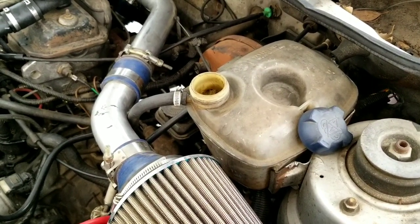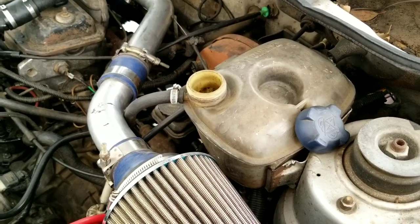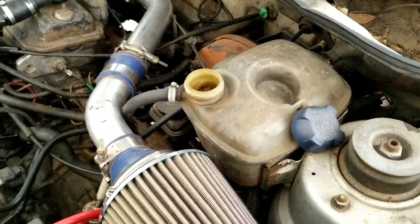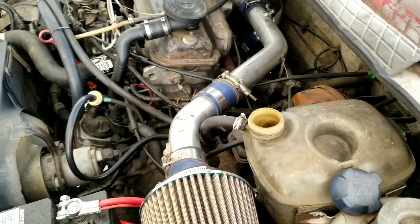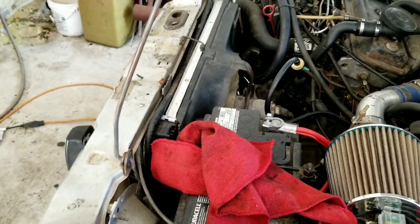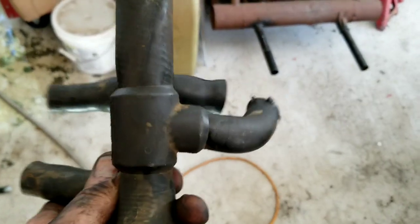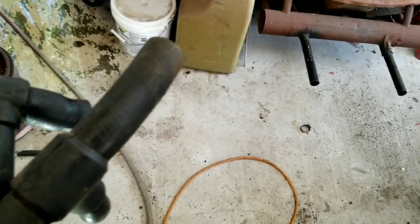If you don't add water to the coolant, your engine is gonna run hot, because coolant does not dissipate heat as well as water does. When you mix them, it does its proper job. If you only have water, you'll have corrosion problems; if you only have coolant, it won't cool as well. Those are things to keep in mind when changing your hoses. I don't have any coolant here so I have to go get some. Please like, share, and subscribe — hope this helps you figure out some of those hose issues on your Rabbit. Those hoses are completely the most garbage hose system I've ever seen — this stupid triangular hose. I don't know how they couldn't have figured out a better way to engineer that.